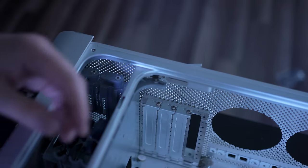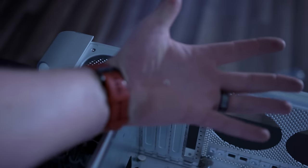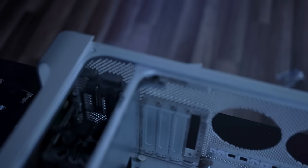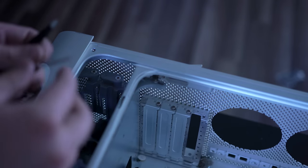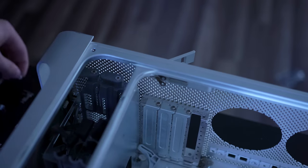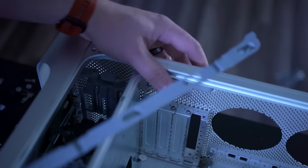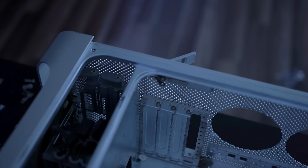You just hold down one side and push on the other side with something - I'm using screwdrivers and tweezers and it just popped off into the case. That little guy right there is all you needed to pop out. Put that in your keep pile, then come back to the pin - it should just push right out the bottom, maybe needing a little persuasion with a screwdriver. Once that pin is out, this latch is completely free. There are a couple of nylon washers you want to keep with it, and then the whole plastic latch locking mechanism tray slides out - keep that piece as well.